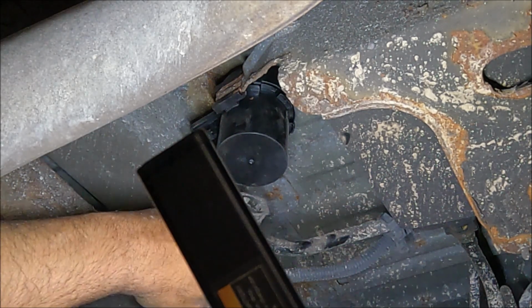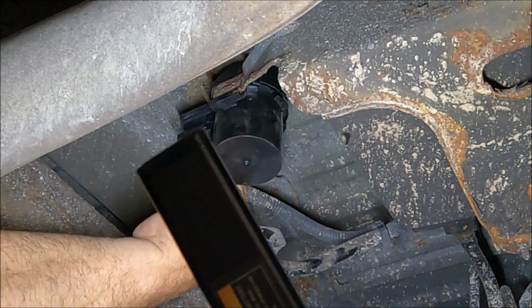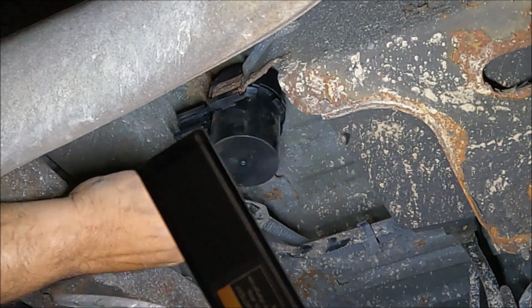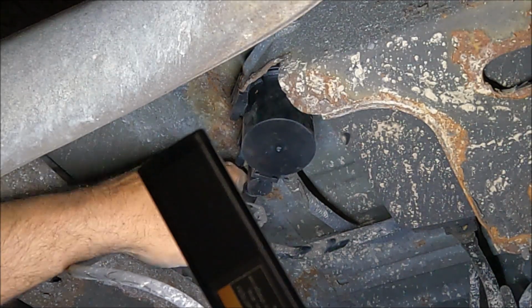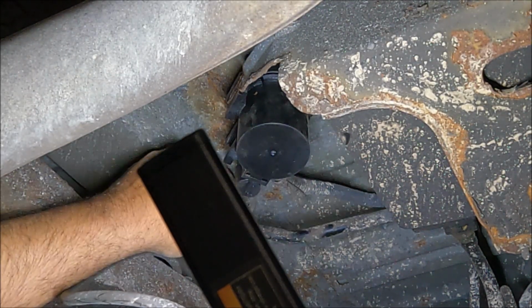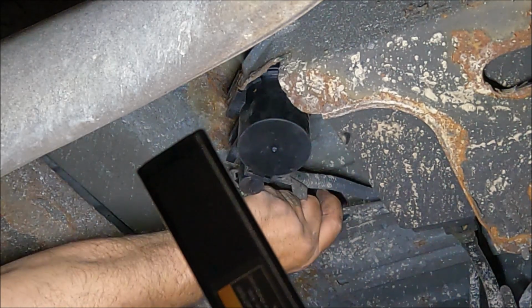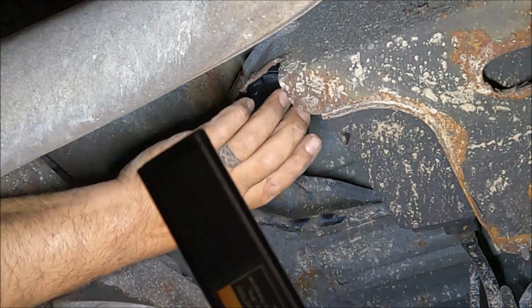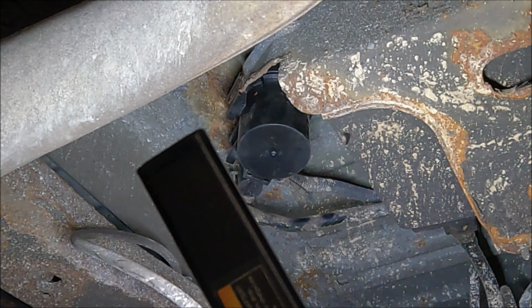This electrical connection, that clipped in there. That's kind of easy to do blind. And then the hose, you bend the bracket so that the hose lines up nice and simple like that, and then just little twist, little push, and the hose is on, and you could visually see the tabs engaged the outside of the hose, and that is it. Well, hopefully that's the problem, because that was an easy fix if it was, and they're pretty inexpensive.